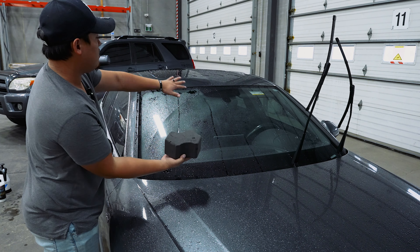Straight motions. Now we're gonna dunk this back into our bucket to make sure we get rid of all the contaminants that are trapped in the fingers of the UBS. This is why this is amazing for a rinseless wash — it traps all the dirt in between all these little slits. When I'm ready to dunk the UBS sponge back in to get back into the contact wash, I'm actually gonna open up the pores as I'm dunking it in, so that I loosen all the dirt in between. That way they find their way down into the dirt trap.